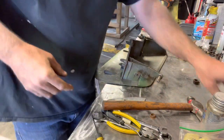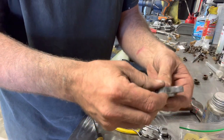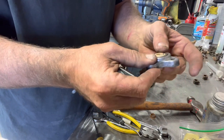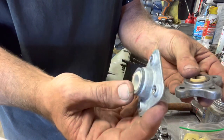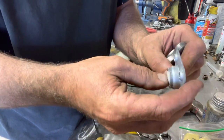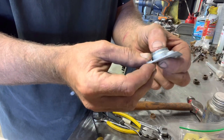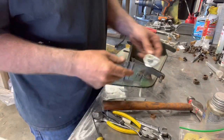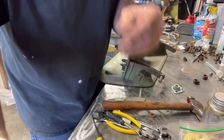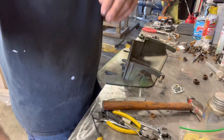Let's see how quick I can put these together. Here's the original GM bearing — or bushing/bearing — and it's not horribly worn out but it is pitted from corrosion. Here's the new one: you can see the difference — one's a stamped piece, the other's a casting with a pushed-in race. I thought about keeping the originals because it looks like a better-built product, but the new ones are fine and they're new, so I don't have to worry. New plastic bushings — one you've got to cut to length — two new guides, four new springs, and then the headlight mount kit.